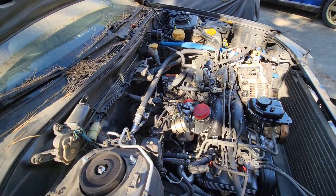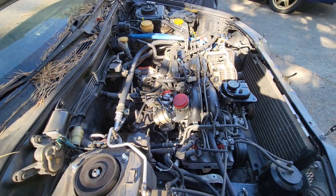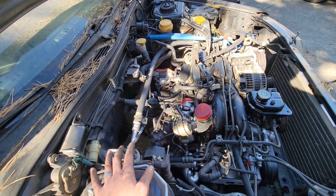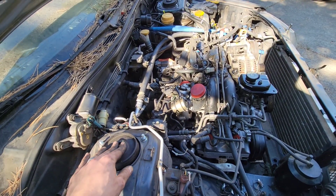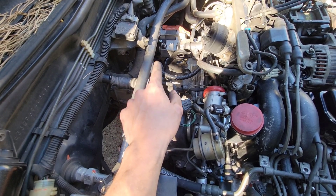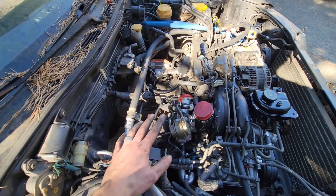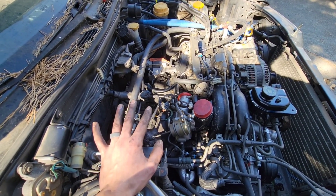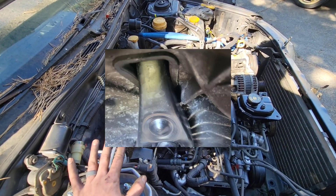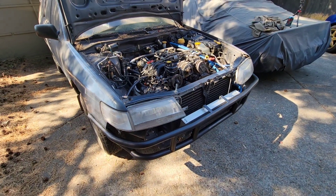One thing I forgot to get a clip of: we actually found that the fork — which is an 06-plus WRX fork to match the clutch — was actually interfering with the inside of the bell housing of the 03 Legacy 5-speed, and we clearanced it with a file. I believe that might be related to a thrust bearing failure I had on my last engine after only about 2,000 miles. So if you're using a non-turbo phase 2 five-speed with an 06-plus WRX clutch setup, definitely check if the fork is going to interfere. But I think that's going to do it for today — thanks for watching, see you guys next time.